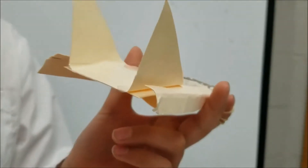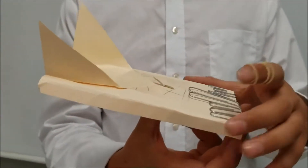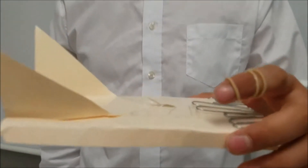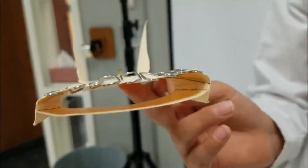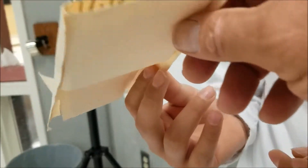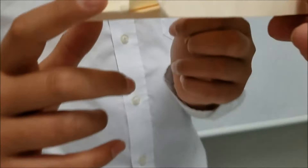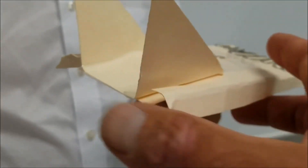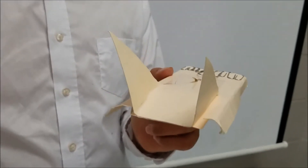The purpose of that was to help reduce the lift on the back of it, so it can go farther without flying up everywhere. There's lift in the front caused by the air scoop, which makes it fly up. To hold it on the ground more, we added this little flap — almost an inclined plane or ramp in the back. These modifications made it work really well.